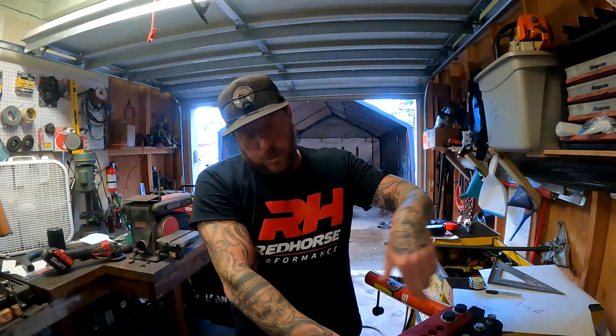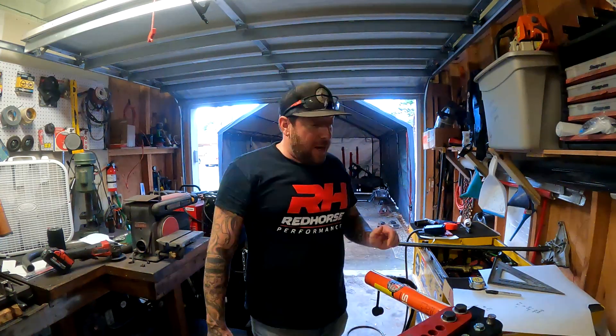Back today after doing the frame notch. I can't do the whole tube front end yet, but I want to just get the front bar in and then get started on the back. The rain's finally clearing up, I hope it holds out. We'll get a little bit of the front end cut, get the tubes bent — the one main tube that goes across the front bed — measured out and welded in. There's another hurricane coming, hopefully a lot less and not quite hitting us.